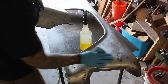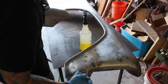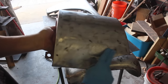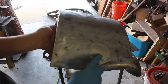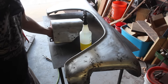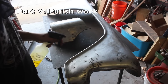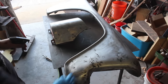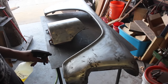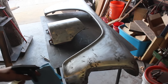I've got this about as good as I'm going to get it. Some of these spaces are kind of hard to get into and the dents are pretty small, so body filler should handle it. I also did the cowl, and just like I did on the other side I cut out the antenna hole and did a little patch panel there. Next I'm going to blast it with some metal prep, shoot it with epoxy primer, do the filler work, another coat of epoxy primer, and put it back on the vehicle. I'm kind of working through the whole vehicle one panel at a time.